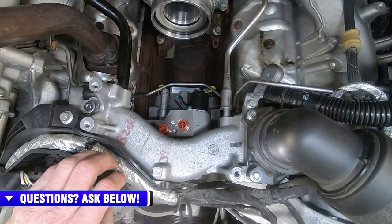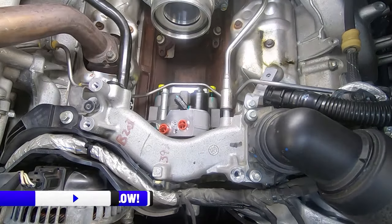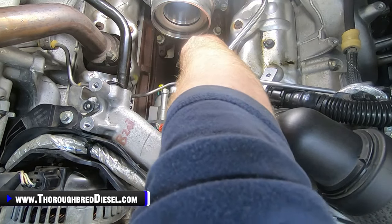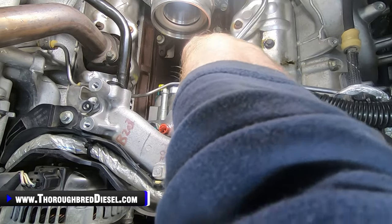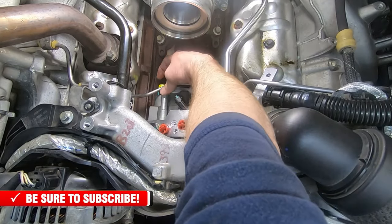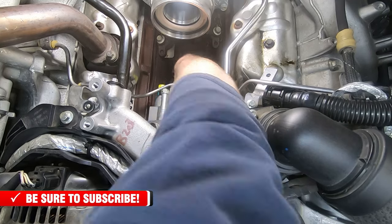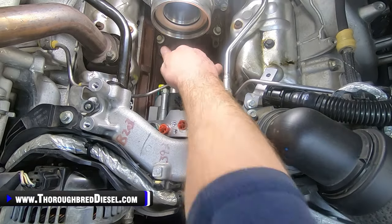And then we will come back and we will torque our, I'm sorry, we didn't have the light here for you guys. Excuse my cinematic shortcomings there. Then we will come back here and we will tighten up our mounting nuts here. And before we tighten up the pump, the DCR pump needs to be seated flush against the cover, and then we'll hand tighten all of our bolts down here. But you don't want to use these nuts to pull the DCR to the cover. You should be able to engage that front engine cover by pushing the DCR pump.